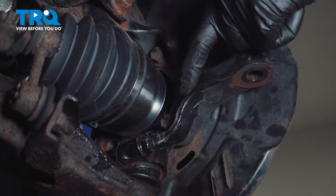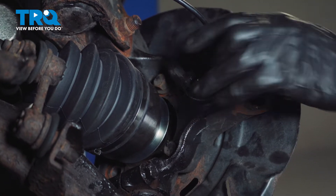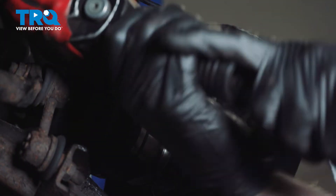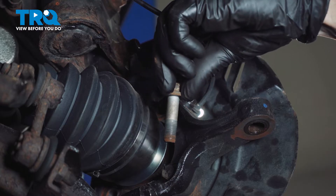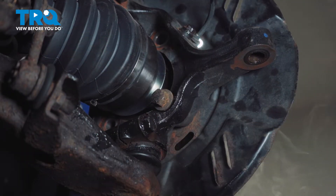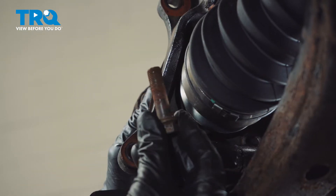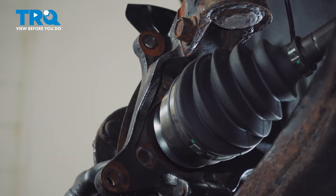The next thing we'll do is continue on to removing our four 14mm headed mounting bolts for the wheel bearing. You'll find that you have two of them along the front side, and then we'll pivot and remove the two on the rearward side — they're pretty much in the same exact area. We can then make our way up to the last mounting bolt, which is the hardest to get to. We'll still use a 14mm, just a different tool.